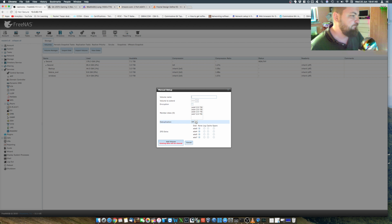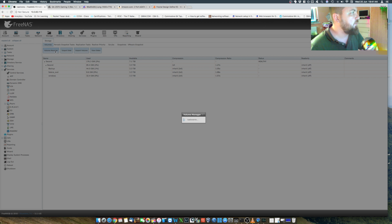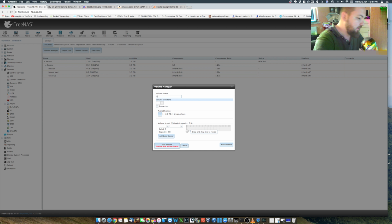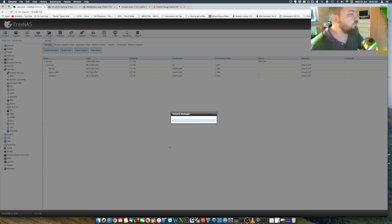I don't know, I think you are perfectly fine like that. So let's create the first one. Encryption, no. We are not going to extend any volume. We are just creating a new one. All the drives, RAID-Z, create volume. Let's wait a second.